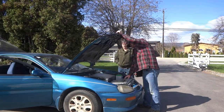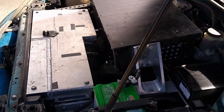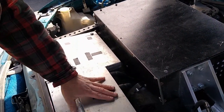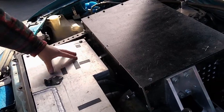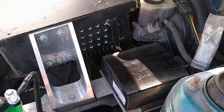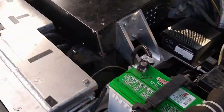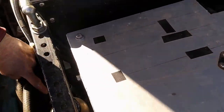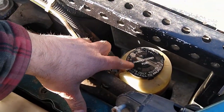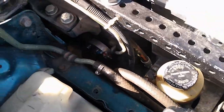Looking under the hood, you can see again how well engineered this whole setup was. We've got additional batteries under here that complement the battery pack in the back. We've got a DC-to-DC converter here which keeps our 12-volt battery charged. And this is the little power steering unit from a Toyota — when I looked it up online, it came out of a Toyota MR2. You can see that runs up into the main control box.